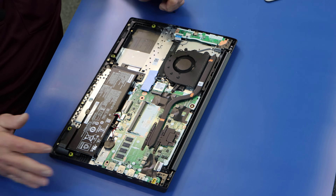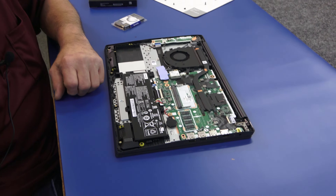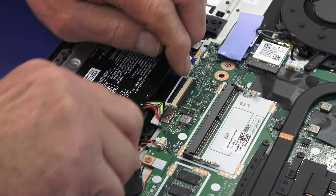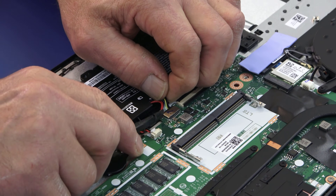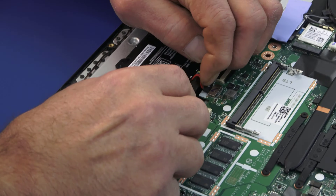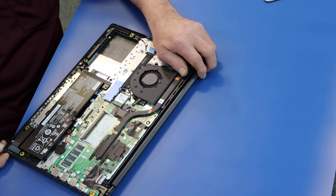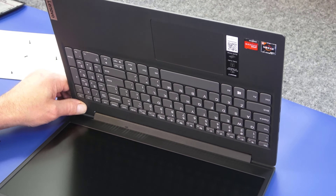So now I'm going to flip it around here. Even though we're not going to be doing a whole lot in here, I am going to take a minute and disconnect the battery — I want to discharge any residual juice that might be hanging out in there. The battery connector pulls out of the socket here — just pull straight back. These are a little tricky sometimes to get a hold of. There, I pulled it back away. So now we're disconnected. Just take your time when you're disconnecting that; you don't want to damage those wires. I'm going to hit the power button a few times just to make sure it's all discharged.